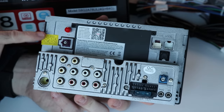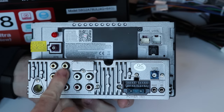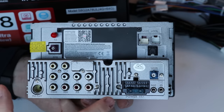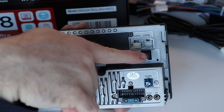Let's have a look at the other side. Up here is the 4G mobile antenna, a GPS FAKRA connector, and over here we have a bunch of RCAs — subwoofer pre-out, front video in, rear video in, video and audio auxiliary input, and front and rear left and right audio pre-outs. So you've got five RCA pre-outs in total: front, rear, and subwoofer. Over here we have the sockets for the USB inputs. And ATOTO have also given us an SPDIF digital optical output, so if you have an amp or a DSP with a digital connection, you can get an optical cable straight from this device for a completely lossless signal — no nasty electrical interference from copper RCA cables. That is a really premium feature.